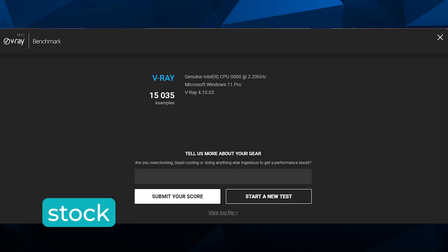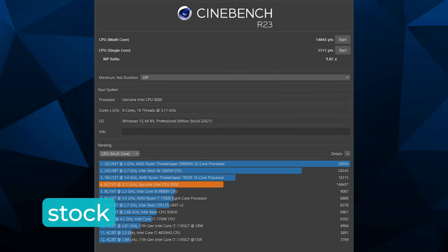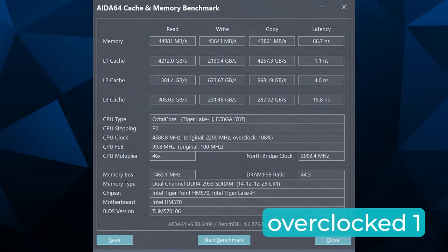A 6600 XT is going to give you everything you want for 1080p and probably 1440p gaming — you don't need something as high-end as the 7900 XT. If you want consistently over 120fps even at 1440p in pretty much any title, even with an 11th-gen Tiger Lake mobile CPU crammed into a motherboard, you can do it. For artificial benchmarks like V-Ray and Firestrike, the CPU-GPU combo lines up about where you'd expect. It's a little off-putting that the CPU shows up as 'Intel All Zeros' — usually that's an engineering sample — but they apparently have thousands of these, and the i7-11800H is the closest match to what we see in CPU-Z.